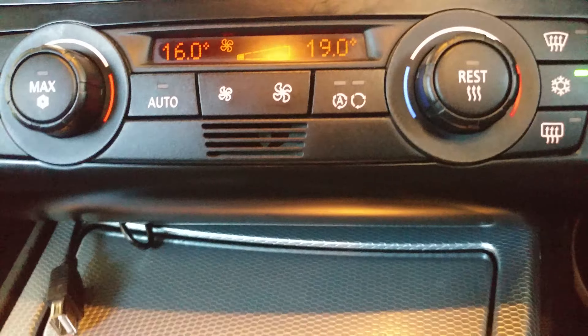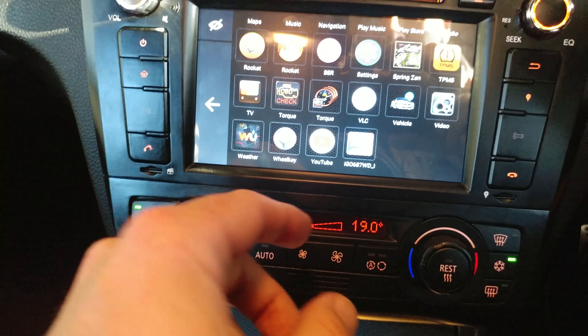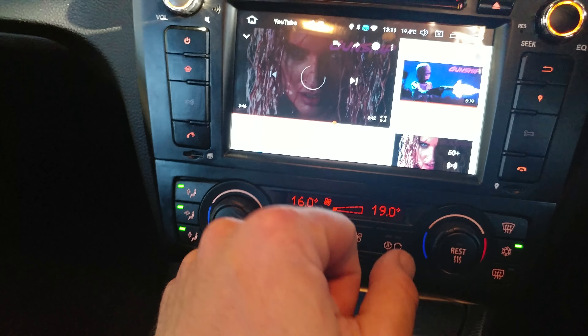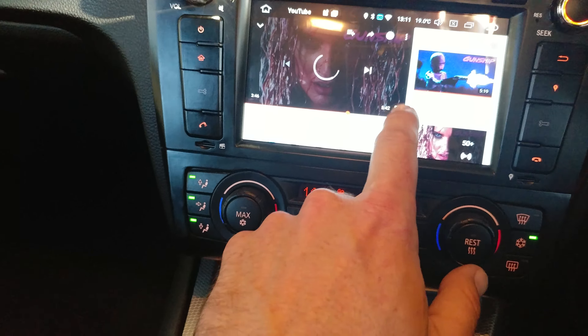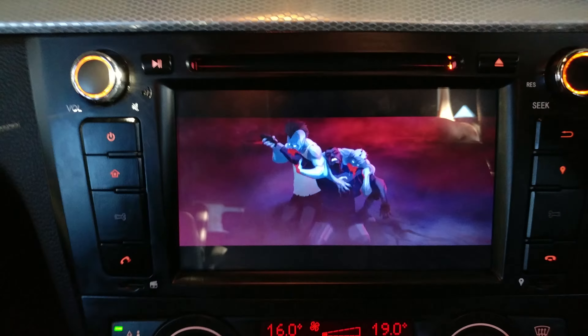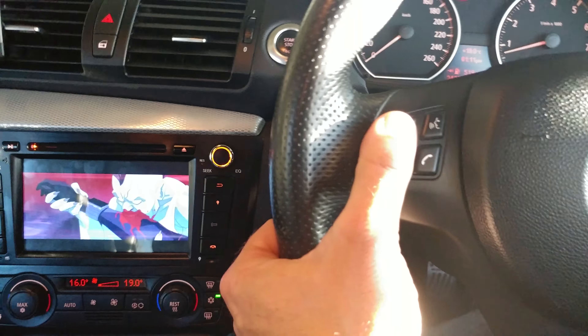All the options buttons I've removed. I just pulled the CAN bus cable straight out the back of the aircon control where it normally sits, it sort of loops back around a bit, and disconnected it and everything's working. Because the head unit is so well integrated with CAN bus, I don't think you even need the buttons anymore. I'm not too sure about heated seats and other options — it may well talk to them. It's quite possible because I've done a lot of work with the CAN bus integration obviously.